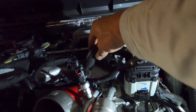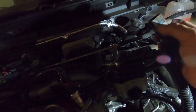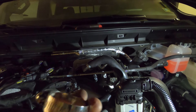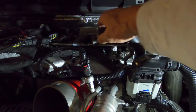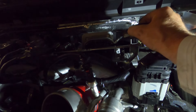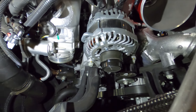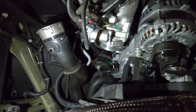Don't forget to put the little bushing back on — the grommet sits in that for the silencer on the air intake. Make sure all your wire holders are back in place and everything's plugged in and looks good. We can take and put our PCV breather hose back on. You can reuse the old clamp — just jam the hose down and it'll still stay — however Banks does give you a replacement clamp, which we're going to use. To get the old one off just wiggle it down the hose.